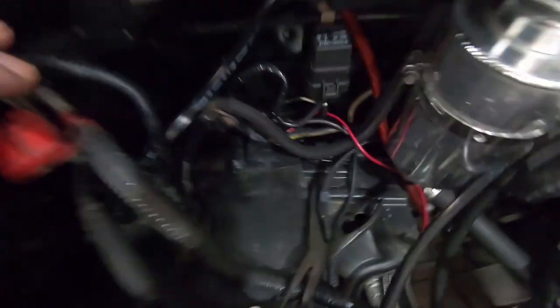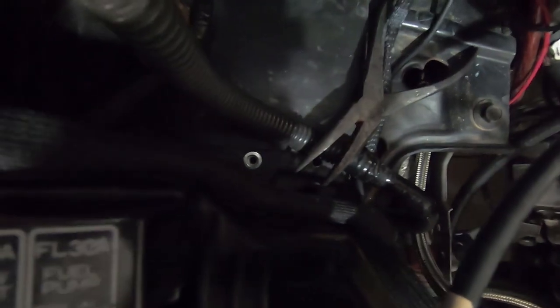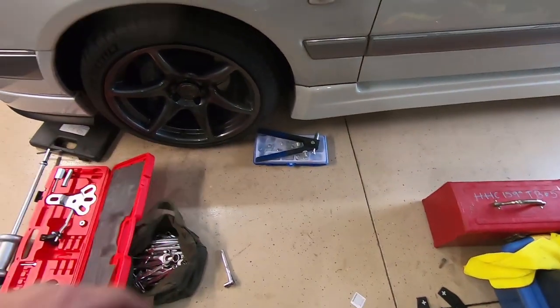Good morning, next day in the TueZday garage, and I have actually been doing a lot of work, but it's been a long ride on the struggle bus. Trying to figure out my battery mounting situation, decided to be clever and use riv nuts. Got one there, I got one there. That way I can mount the battery nice and easy. Had to make some custom things for that. Doing this, my riv nut gun kept falling apart. Some Amazon junk. Finally, I got two done, so that was great, but it was painful.